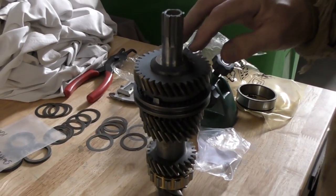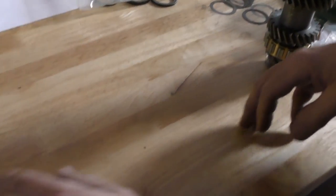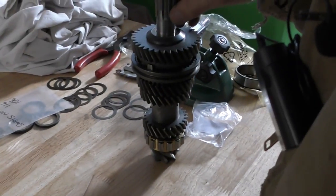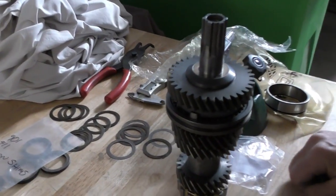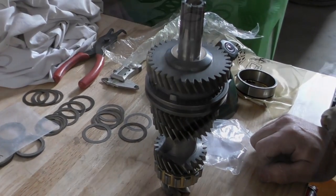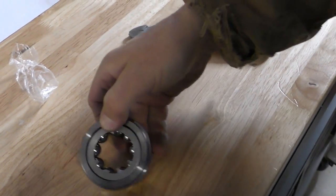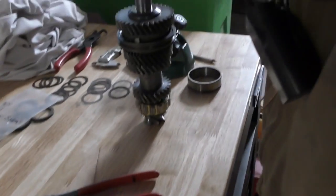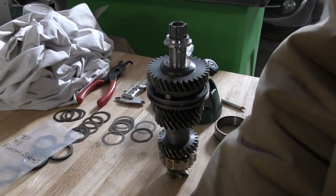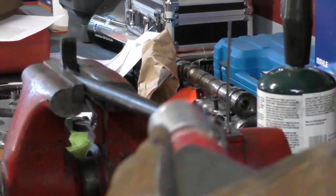Our final spacer has gone on and the last thing we need to put on is our bearing halves — but this is the old bearing, so I'm going to grab our new main annular bearing. I'm going to heat it up with my hot air gun, drop it on, and then we're ready to assemble this into the intermediate plate and take some pinion shaft measurements. The new annular bearing is a three-piece bearing: this part goes into the intermediate plate, and then there are two inner pieces — I need to heat this up to drop it over, and the other one will come in on the back side when we assemble it all together. We heat it, not press it.